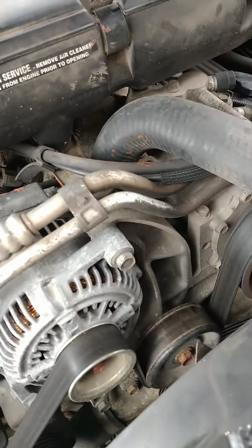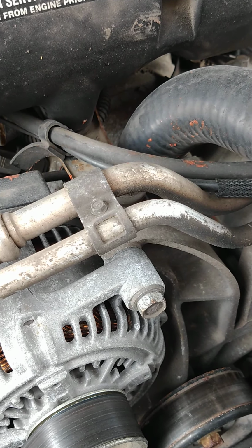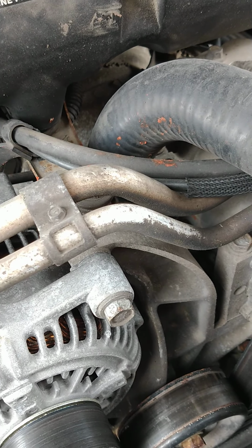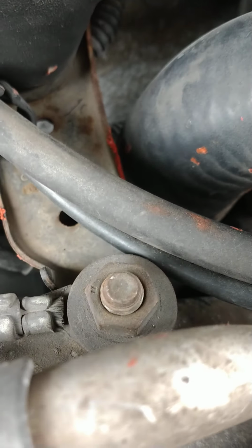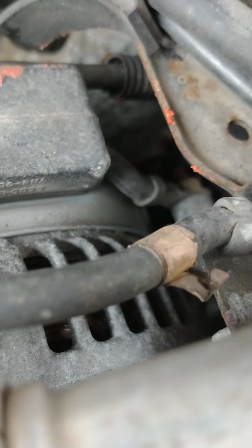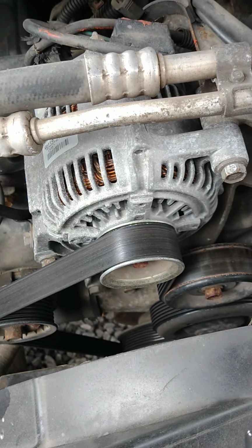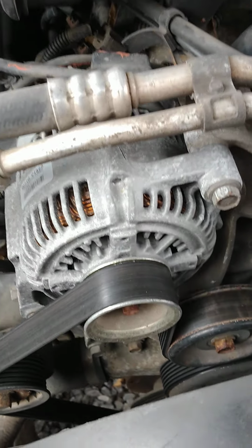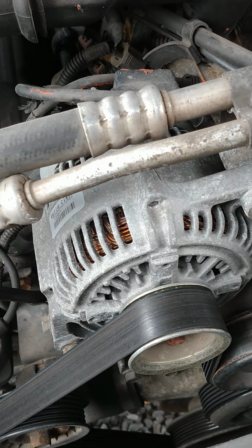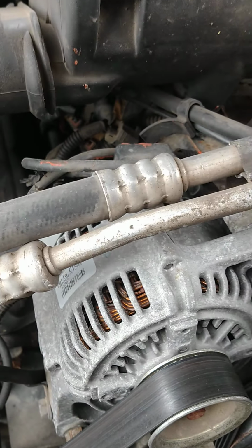Another thing I'm going to have to address sooner or later, this thing only gets up to about 130 degrees, but the engine, when you shut it off, makes some funny sounds like tink, tink, tink. So that tells me it's getting hotter than 130 degrees. So I'm thinking they probably damaged the terminals or something on the temperature sensor, which is right down in the middle of nowhere. It's probably underneath that rotating mechanism that charges your battery back up. If you want to be technical, you can call it an alternator. I call it another huge malfunction of Dodge. Pretty much the entire electrical systems are junk on these, but it's okay.